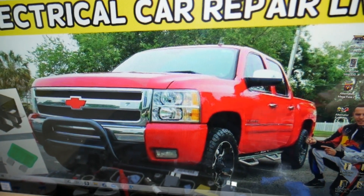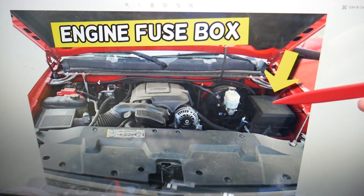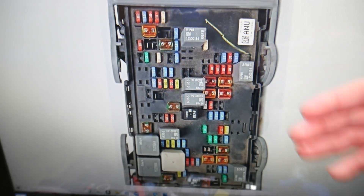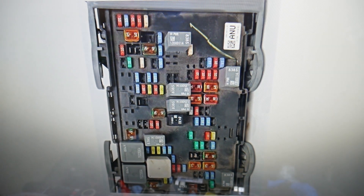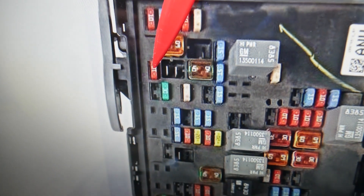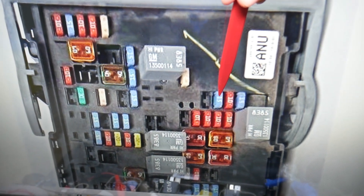Then we need to go ahead and open the hood. Once we do that, on the right side you have a fuse box under a cover. Open that fuse box, and you'll find the fuse box layout just like this one here. For the brake lights, we have two more fuses to check here. By the way, if you need to buy any fuses, relays, or parts at a good price with quick shipping, we will put the link in the description of the video below. The first fuse to check is fuse number one — right here. Then you will need to check fuse number 49, which will be in this row right here — this fuse right there.